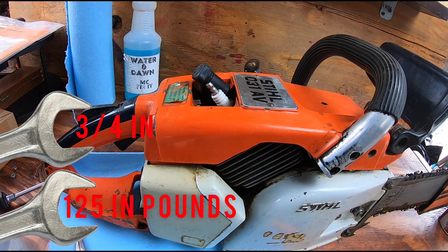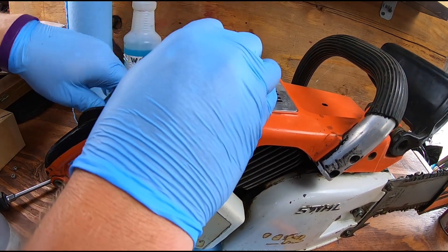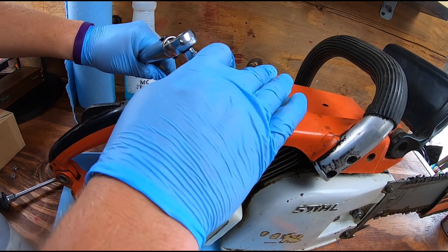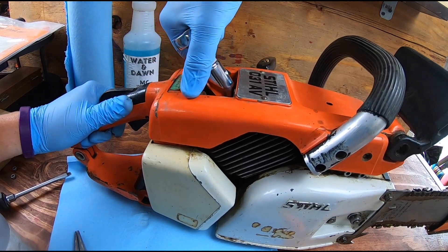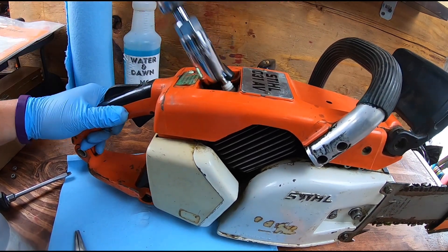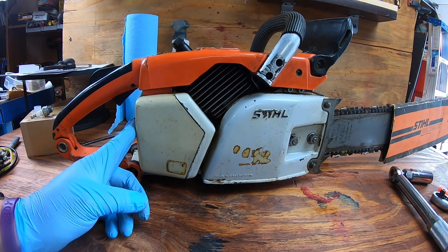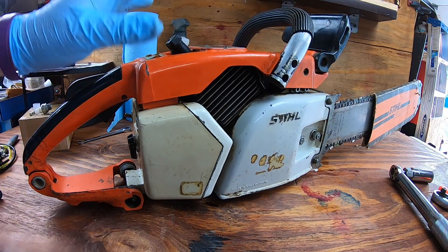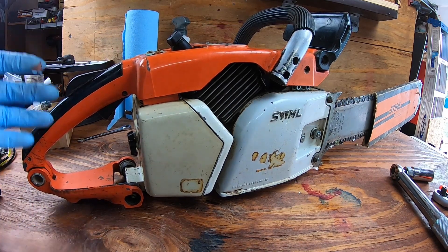Go ahead and put the spark plug back down in there. You've got to really bend the boot out of the way. Once it's in by hand, I'm going to set this to 125 inch-pounds, which is a pretty common torque spec for spark plugs. I couldn't find the exact spec online, but I did an Echo trimmer the other day and it was 125 — not the exact same plug but close in size. That little snap is all you need to hear. So now we have a new carburetor and spark plug — that plug was okay but you could have changed it out.